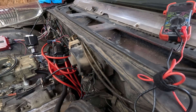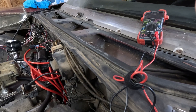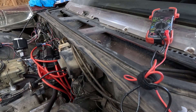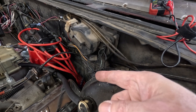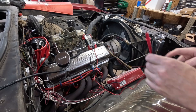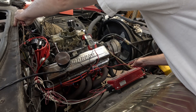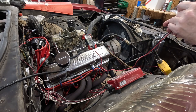Got to figure out why it's not getting power. If you are getting 12 volts here with the ignition on, go ahead and turn it over and watch — make sure that it's still 12. If it drops below 12, the MSD is not going to fire. It does require 12 volts. If yours reads like six volts, it's probably because the ignition wire has got a resistor — you want to replace that with one that does not. To test the ground on the firewall, I'm using a known good positive. Touch it there — 12.32 volts. So I know it's not the ground to the firewall.